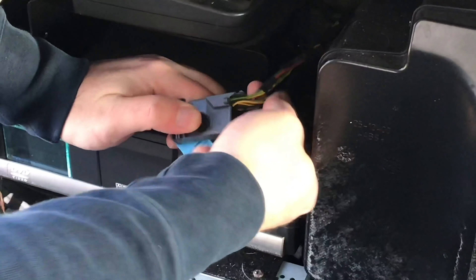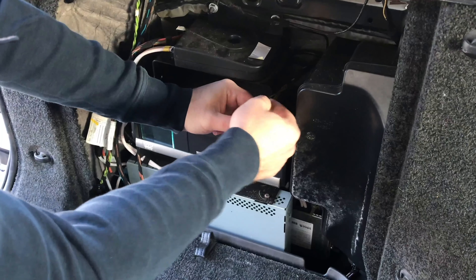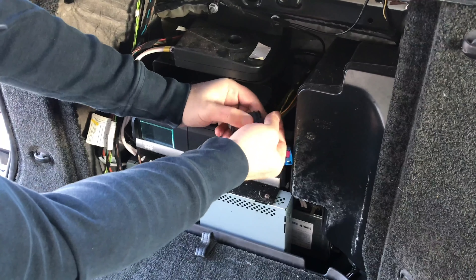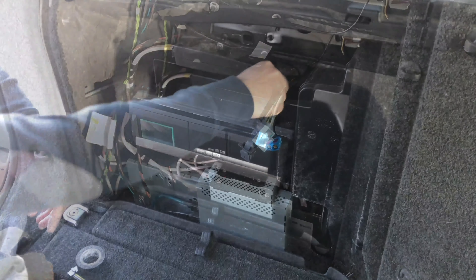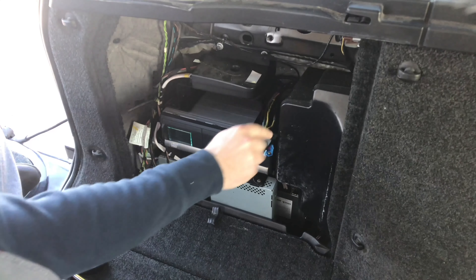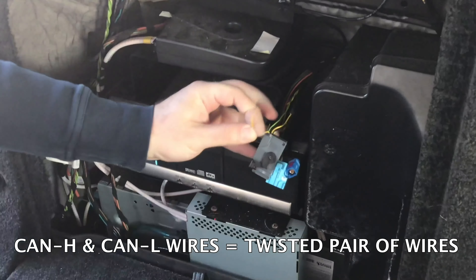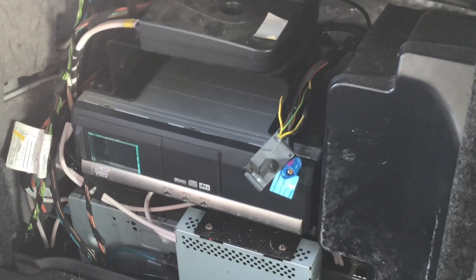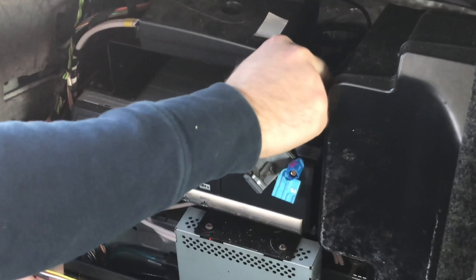For the interface installation: whether you have a full-size Range Rover or Range Rover Sport, installation is identical. The only difference is the navigation DVD ROM location — in the Sport and other models it may be under the driver's seat, while in full-size vehicles it will be in the rear trunk. Open the cover to access the DVD ROM drive. Note: if you have a factory DVD player, NavTool also offers a video-in-motion option. Most of the installation for Apple CarPlay and smartphone mirroring is done at the navigation DVD ROM. Remove the screws on the side of the unit and pull it out.